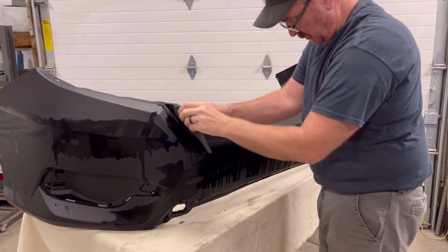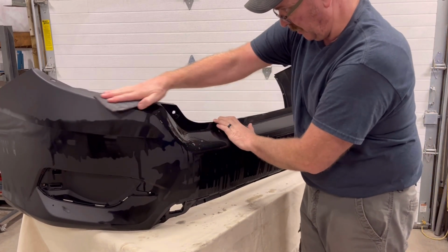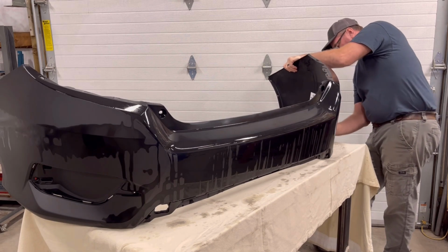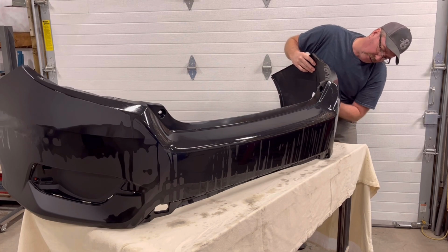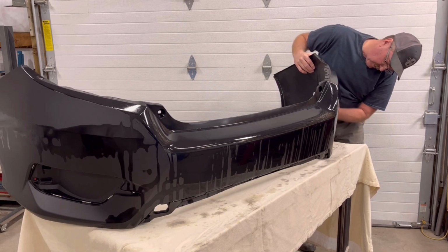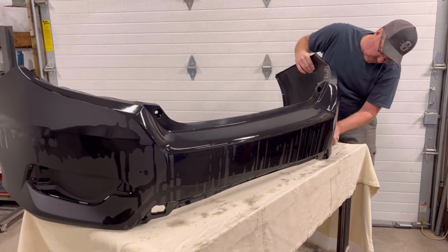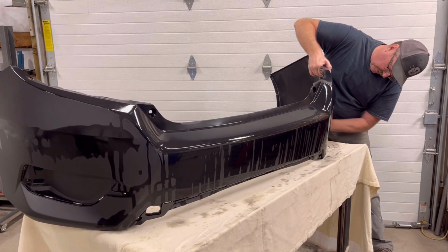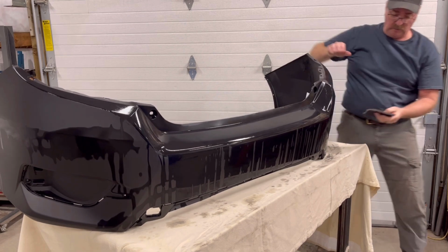we're going to scuff these holes for these clips. I believe this is where the trunk is, so we want it to look decent there. We want paint to stick back underneath the panels. You definitely want your paint sticking in beyond where your lights may be, or like these areas where a light housing is. You don't want paint chipping off around that later, so be sure and get your sanding back beyond where you're applying paint, especially if you gotta spend all the money to paint it. You don't want it falling off in like a year's time, and it very well could.